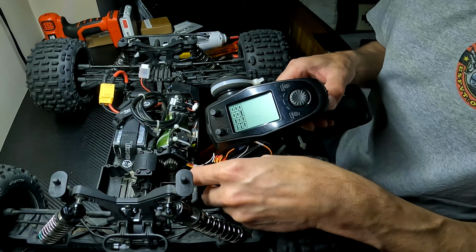The next thing, if you ever get some silicone earplugs for your diffs, you might have an extra one or two around, and that's what I use for this. There's probably something better, but this seems to work pretty good. So take our little goopy thing, I'll peel this back a little bit of it and kind of stick that in to the middle of all the wires. Roll this into a little cylinder, wrap it around your wires like this.